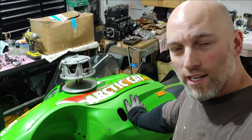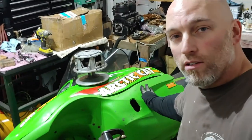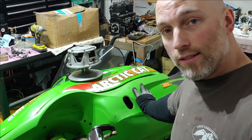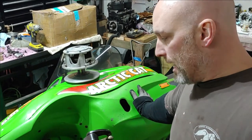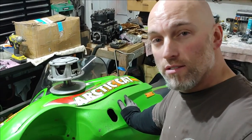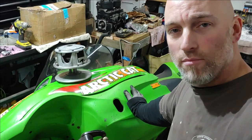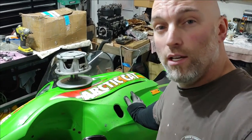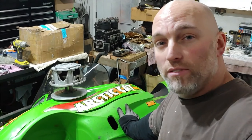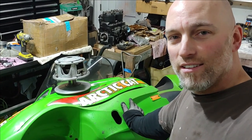That's it — I just wanted to show you real quick how I pop off clutches on these Arctic Cats. Pretty simple: pull the clutch bolt out, get your bolt of choice ready, put some Teflon tape on it, secure the clutch with a pry bar, and just screw that bolt in and crank it till it pops. If you're not subscribed, please feel free to subscribe, hit the alert bell for notifications, drop a comment, ask a question — I'm always happy to help. If you know anybody interested in this type of content, feel free to share on social media. Thanks a lot, take care!